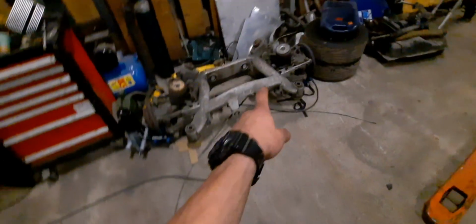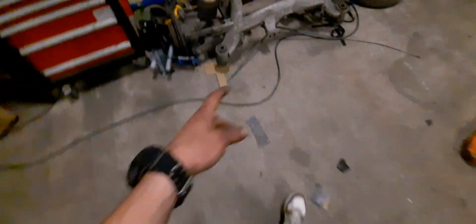I don't have a camera stand, so I cannot film everything or just put my phone somewhere. What I did is I cut out this square and I cut one of the wheel fenders off, the arches. It also has the suspension on it, so I took the original suspension of the car and tried to fit the BMW subframe. It won't fit because of this frame wheel. It goes over here and then makes a little bit of a turn to there. But with the BMW one, the airbag for the air ride is over here, so I need to change this structure and make some mounts.